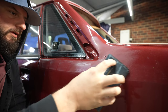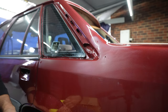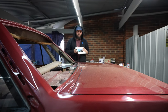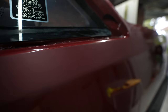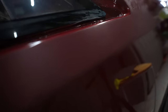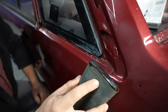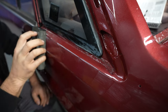Next up I'm going to change my sandpaper to 2000 grit. The higher the number on the sandpaper, the finer it is. Let that dry off — just a couple of little spots here. So this is your 2000 grit sandpaper; I'm using 3M 2000. And now you can see here there is no more orange peel — it's completely flat. This part here I didn't do properly, but you can see how it's not completely flat yet. Using the 2000 is just going to help me buff it up a lot quicker. You could probably buff with the 1200 but you'd be there for longer, so you can spend your time sanding or buffing — I think sanding is quicker.